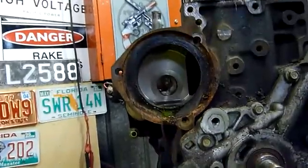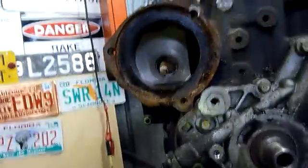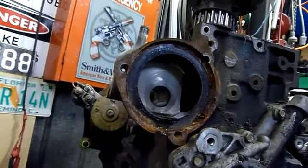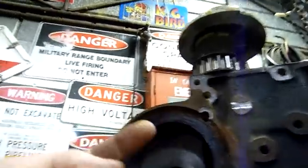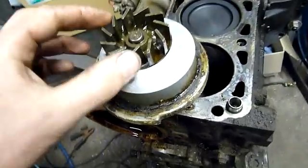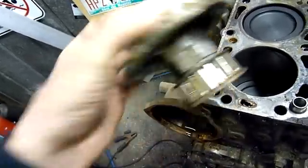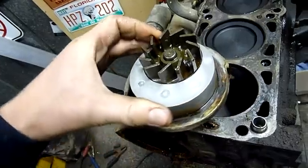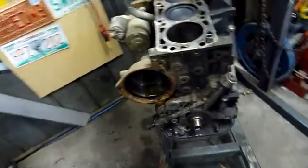The water pump's out for the first time in a while and this thing's almost too clean to have been getting exhaust gases in the cooling system — but then again the coolant's pretty rich. It almost looked like oil; I left a bit to evaporate overnight and it didn't, it just spread out and stayed there — I had to wash the floor. So the syrupy coolant is probably the only thing that's kept this thing from rusting, or it's just got somehow dissolved oil in it. A little bit of corrosion at the top where there's been an air bubble sitting — that's about it. The pump itself is okay, very old, I wouldn't trust it, but no sign of anything apart from maybe a little bit of lube oil coming out the weep hole. Normally when I see these things they're all eaten and pitted and pretty ugly.